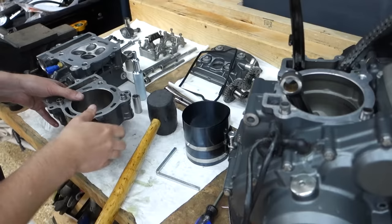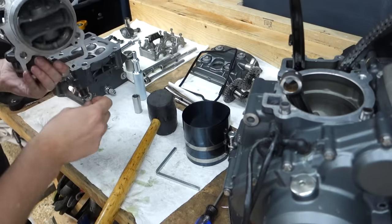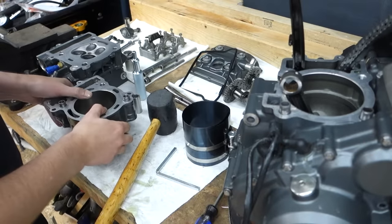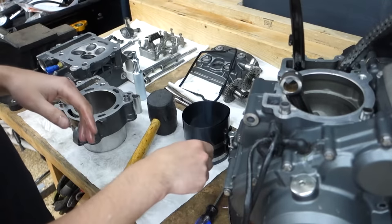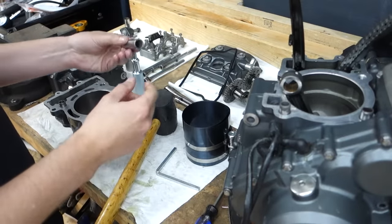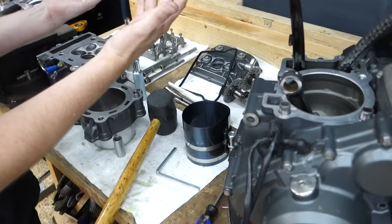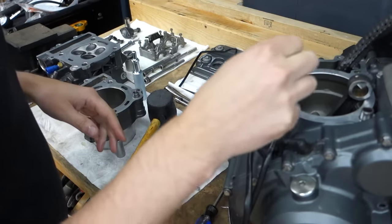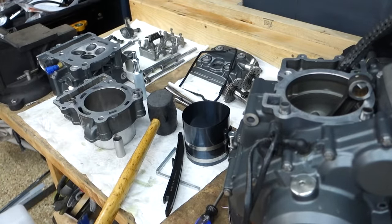Cool, so that is at the bottom here. I'm going to wait on knocking it out because I want to prepare the gasket surface. We're going to poke that down a little bit and then we can shove the wrist pin through. Wrist pin through and then circlip it. But first I've got to get rid of this oil all over my hands. We're going to get a little bit of RTV down there for the gasket.